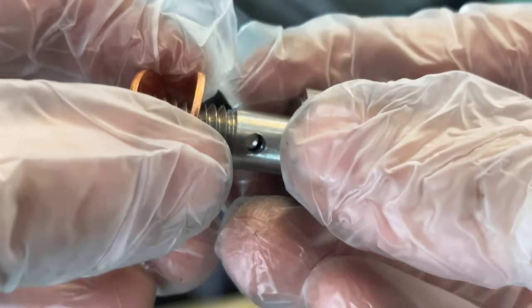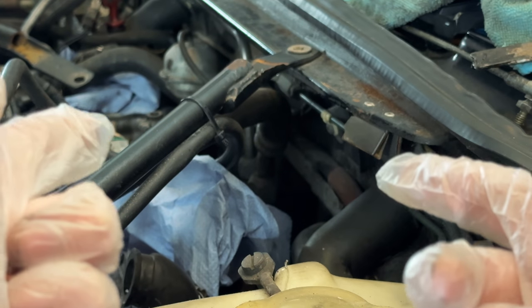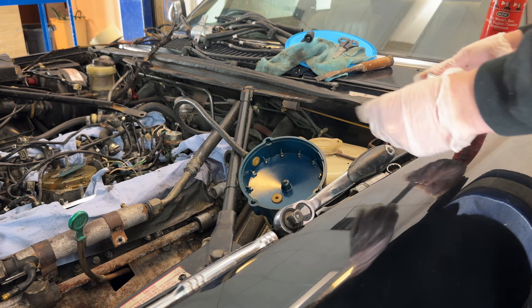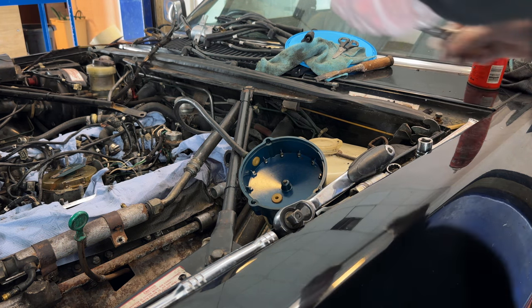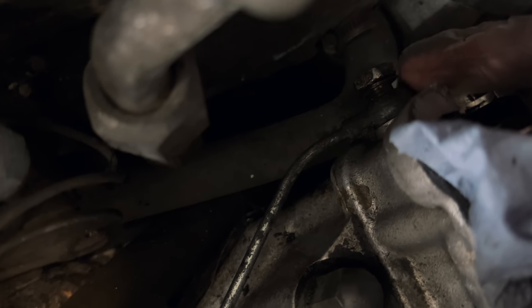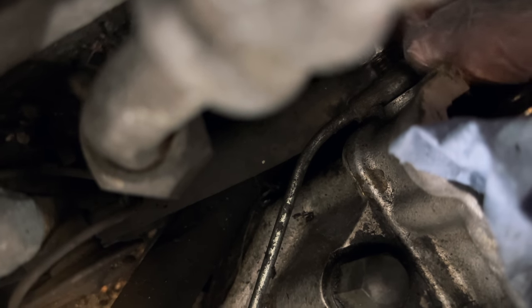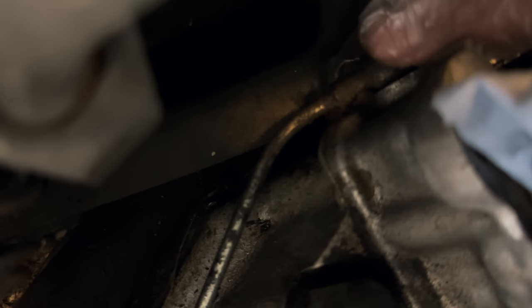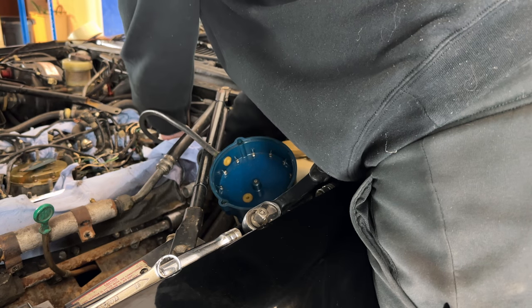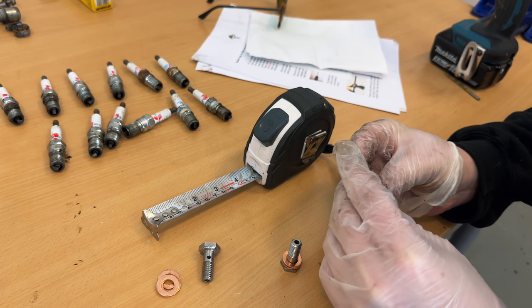This is what you have to order - this is actually an uprated banjo bolt that came from Lithuania. It's a bit longer, the threads are slightly different, and it comes with two thicker copper washers. That goes right in the back there. I've heard they're 16mm - let's give it a go. They're 17. I'm not going to be able to use a socket because there's not enough space. Maybe the originals are a 16 and the upgraded ones are 17. What is a banjo bolt? On the back of the engine there's something hollow that allows oil in. The banjo bolt goes in and the hole there allows the oil to go inside the bolt, out the end, and into the back of the engine. You need one washer on this side and another washer on the inside. That's the new banjo bolt in. I've just done it tight and then a little bit more.